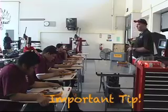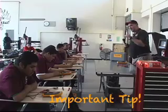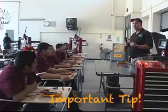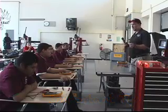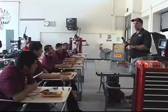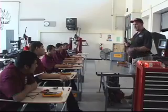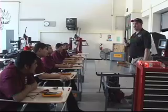There's another very important thing to remember when using this meter. If you're using it to measure ohms, never hook it up to a circuit that is connected to a battery. If you accidentally hook it up to battery voltage, it will blow the fuse — the meter protects itself — and it won't work anymore. You never want to connect the ohmmeter mode to a live circuit.